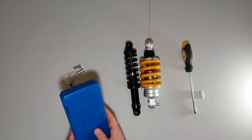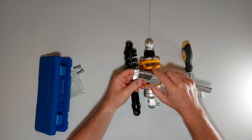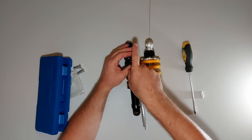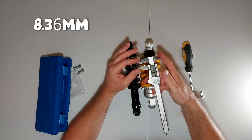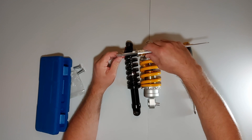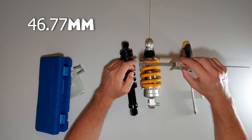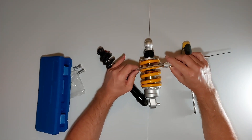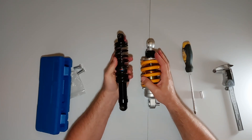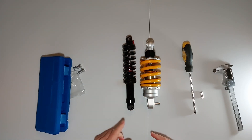Just to give you some idea of the difference in the thickness of the spring - the thickness of this old spring is 8.36 millimeters, and this new one is 11.24. If I measure the thickness the other way, the old one is 46.77 and the new one is roughly 71.85. So hopefully this spring here will stop me going boing-a-wing-a. Anyway, let's go and put it on the bike.